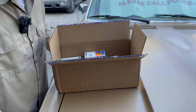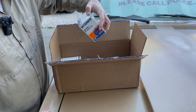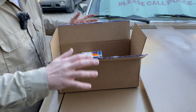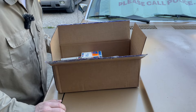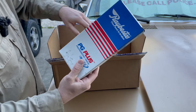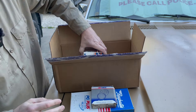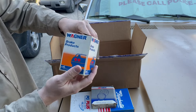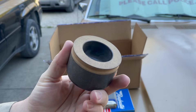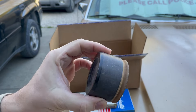We are back with the Grand Fury. I've got a box of parts that look like they came from 1987 — wholesale closeout off of Rock Auto. We're going to address the front brakes again. The driver side wheel is still dragging. We're going to be replacing the soft brake line to the caliper. I've got a caliper rebuild kit — basically the seals — and new pistons. These brand new old pistons are phenolic resin: withstands heat, water, chemicals, and they're really strong.